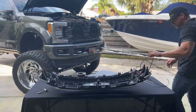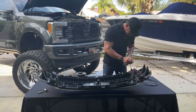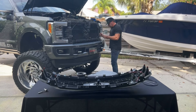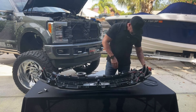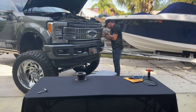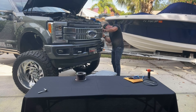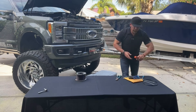On your truck, I recommend using the upfitter switch. If you don't have upfitter switches, maybe add a toggle switch. Some guys do wire it to the headlight, but I'll tell you — these headlights have different levels of brightness. My truck got taken in for a recall and they dropped the brightness of my headlights at night, which shut my grill lights off because I had it wired into the headlight. Then I had to pick a different wire to tap into. Upfitter switches is the easiest way to go — for any reason you want to turn them off, you can.